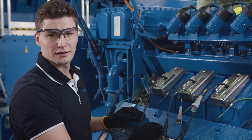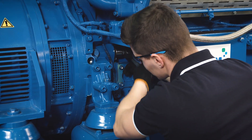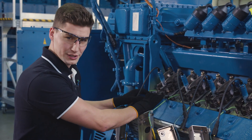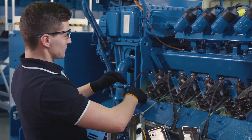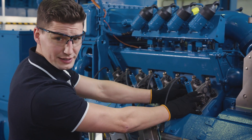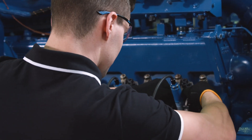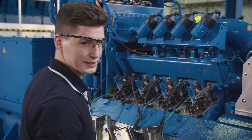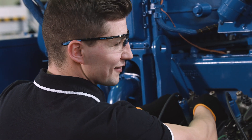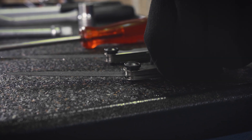Now we're going to do the same with all other covers. B1 TDC has been adjusted. Now we need to check whether this is the correct TDC. Cylinder number one should be at ignition TDC, and cylinder number four, the partner cylinder, should be in the overlap phase. Cylinder number four — both valves are tight. Therefore, both valves should be free on cylinder one. That's been confirmed. Then we start checking it.